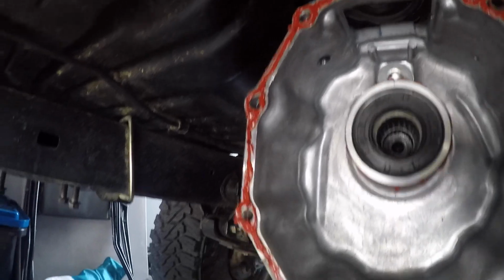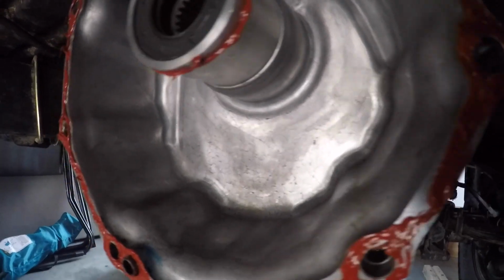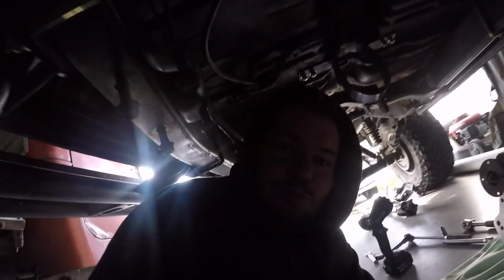I've got this gasket glue around here for the transfer to go on. I've put a little gasket glue around here because it doesn't really seal on that shaft that well. Obviously it seals on that shaft well, but if oil, I imagine, flies around in the bearings there and comes out there, it's going to drop into this cavity as you see in here, and once it's in here it's kind of stuck in there. I don't know if that's just a bit of a fault in the adapter plate. So I've put a bit of sealant around there because once it comes through those open bearing holes from flicking around, it's going to fall onto that. Anyhow, we'll lift this in and into it.